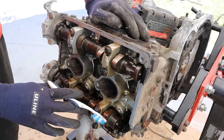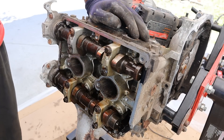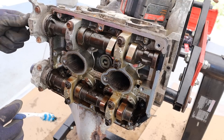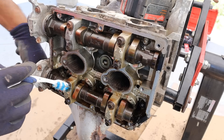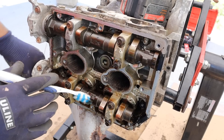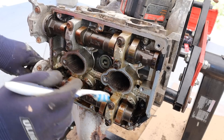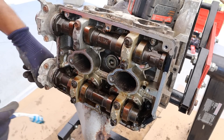The advantage of the dual overhead cam is that with variable valve timing you can vary the timing on each side independently, rather than having one fixed timing — and it's also simpler because you don't have extra parts like roller rocker arms. I've taken apart a lot of engines and never been able to rotate the camshaft this easily. This probably needs a valve adjustment. Also, since this is a boxer, there are only two cylinders on this side — so instead of four lobes with one almost always touching valves giving resistance, this has only two lobes that are 90 degrees apart. The engine's also been sitting a while, so there's rust buildup on the cam lobes.